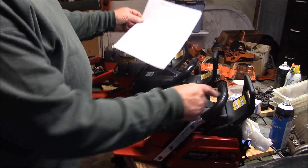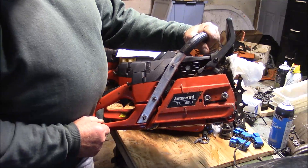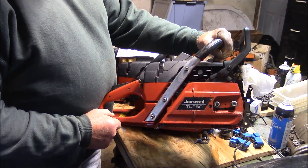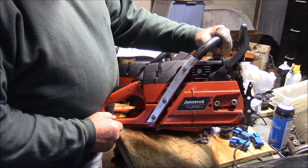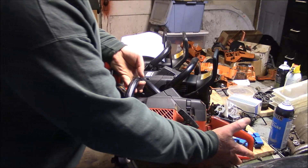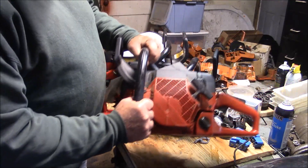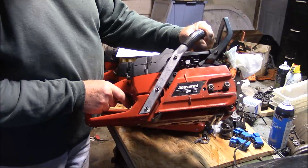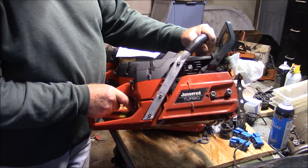What we have here is a 2171. Looks pretty much like the other ones, doesn't it? This one I call a 2175 because it has the Husqvarna XPW top end on it - it's a 51.4 millimeter versus the standard 50 millimeter. And it has a different ignition - it has the later version of the ignition system that's on the new X-Torx. It starts a lot better once I made that modification.